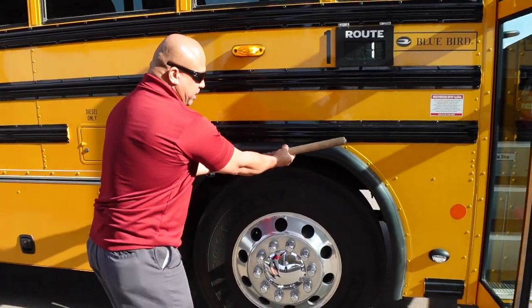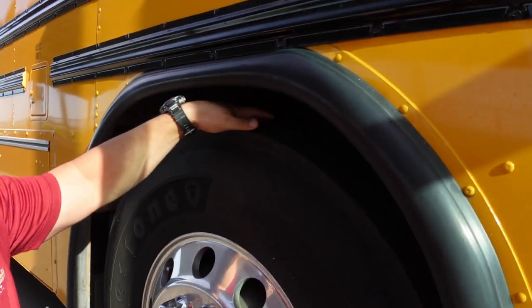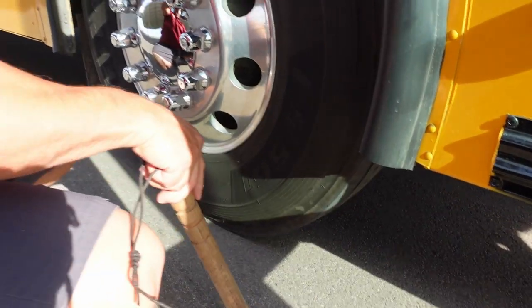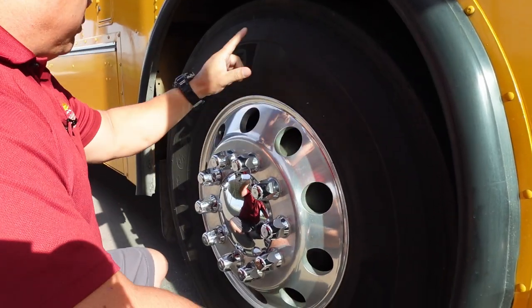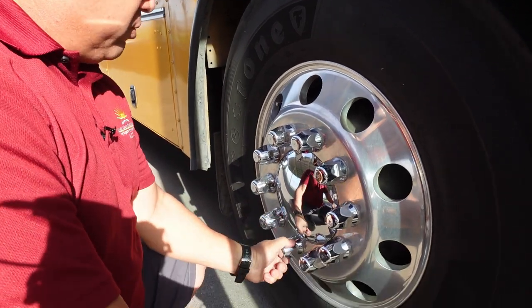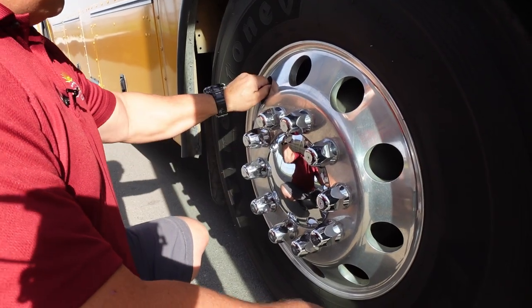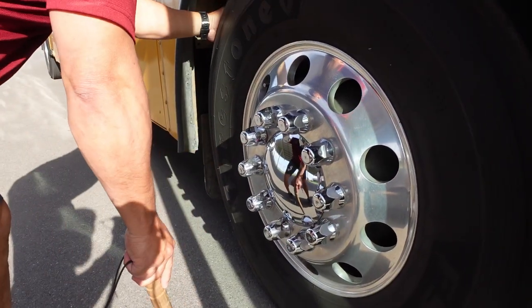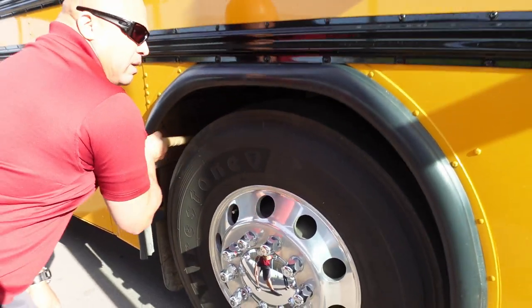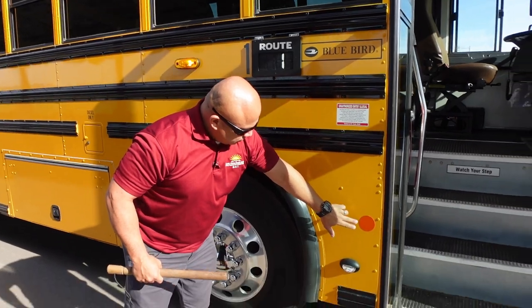Next I'll check my wheel well cover, making sure that's secure. I'll check the tread depth — minimum in the front should be no less than 4/32 of an inch in all major grooves. Also checking for proper inflation, and checking the outside of the tire for any cracks, bubbles, rips, or tears. Checking for any loose lug nuts — indication of a loose lug nut will be cracks or rust; there's no cracks or rust. No cracks, dents, or illegal welds in my wheel. Valve stem is secure. My mud flap is secure. I have a visual on my leaf springs front and rear, and also checking for any foreign objects in my tire. Bus 1 labeled properly, route 1 visible, my reflector is intact, entry light is working properly.